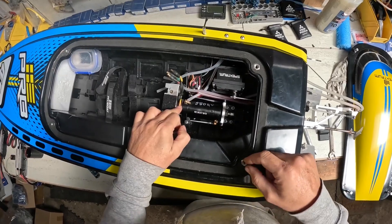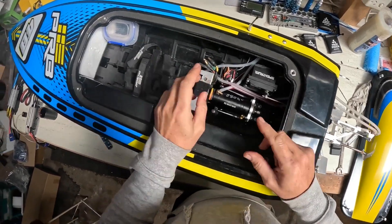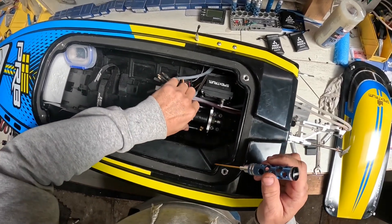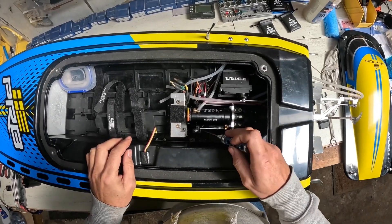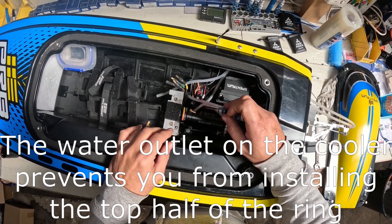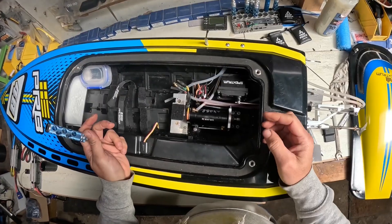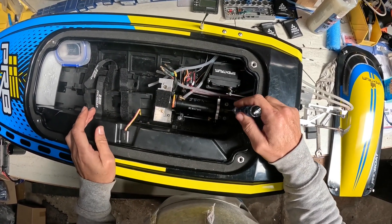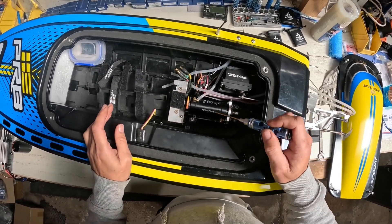A tip if someone's going to put one of these 4070 motors in here: because we don't have the top mounting ring on here to stop it coming forward, even though it's quite firm — what I would do next time I have this out is drill a hole in the side of the mount on each side, then run a cable tie over here just to attach the top of this to the mount, so if the thing does flip over it doesn't try and rip out. We've got six bolts, which is good, but they're only going into plastic.